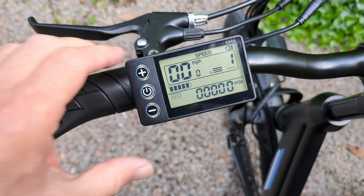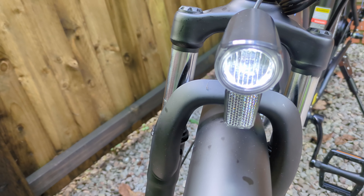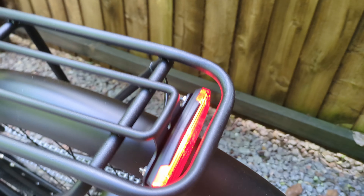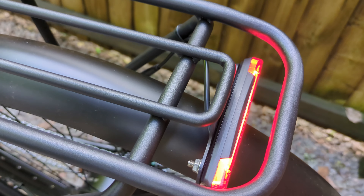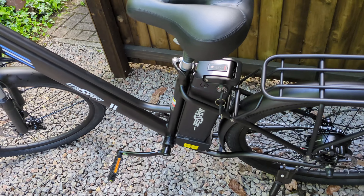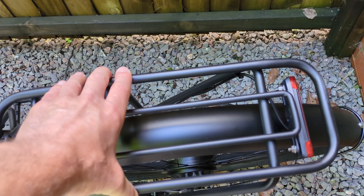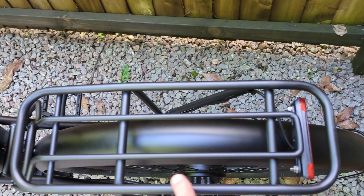Here it is all put together. What have you got to do to put it together? It's not a lot, but you have got to do a few things. The front wheel has got to be put on, the front mudguard has to go on, this headlight which goes on when you put the front mudguard on - so don't forget that. The handlebars have got to be put in with the cap on as well, the pedals have to go on, the seat goes in, and the rear mudguard stays either side need to be connected yourself.